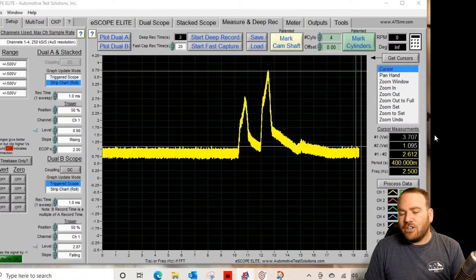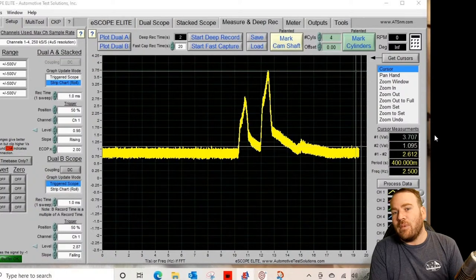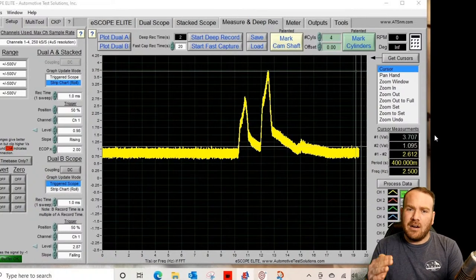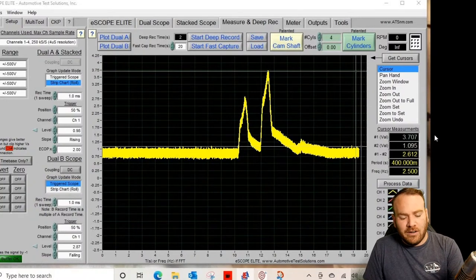Now, there's not a direct correlation of voltage for every make and model. They all kind of vary a little bit. That's where the functional test or the service information is going to give you more information. The guided component test in the Snap-on scan tool, or ALLDATA or Mitchell, will give you kind of a baseline reading of what you should be at idle. But keep in mind, that may change a little bit with elevation. I'm normally at the bottom end of the threshold or slightly below it, but I'm at over 5,000 feet here in Colorado. Thanks for posting that one, Doug.